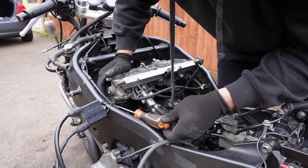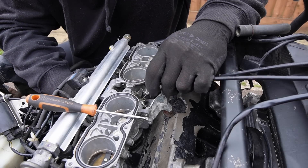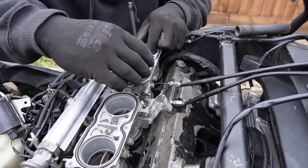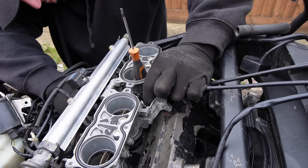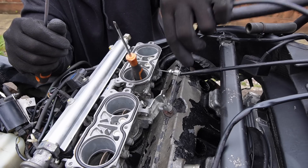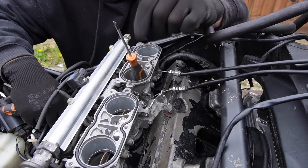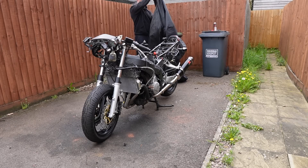I tightened up the six fastening screws to clamp the throttle bodies to the engine. Attaching the throttle cable to the throttle bodies was not fun — wedging a screwdriver into the throttle body helped hold the throttle plates open, meaning the cable didn't have to stretch as much as I tried to hook it up. Honestly this took me about 20 minutes of cursing as there was very little room trying to thread this cable through, but we prevailed and finally had a working throttle.